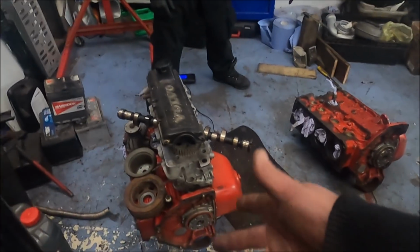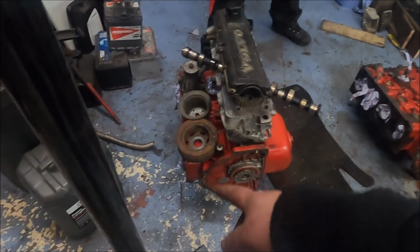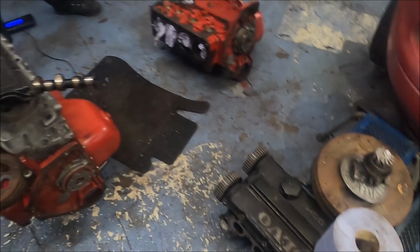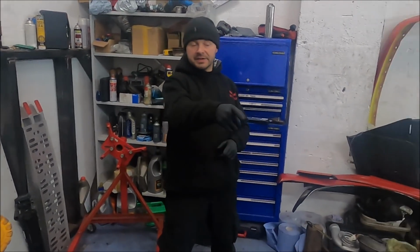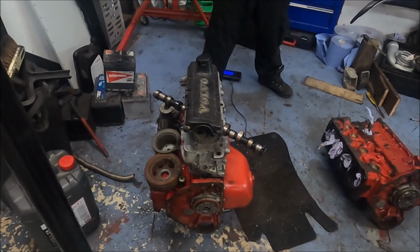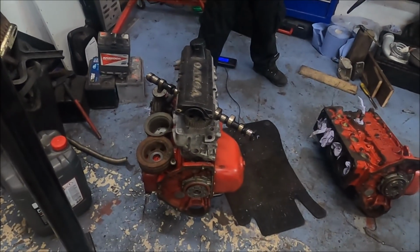And I mean, you can have a 5.5 kilo flywheel. Like I said, I've got a 5.5 kilo flywheel to go on. You could add to that if you wanted to. I've got my crank pulley, instead of that one, it's 0.8 kilos. Obviously a 16 valve head weighs a little bit more, not much I bet. What I'm saying is, you add 100 kilograms now, you're not adding another 100 kilograms with the gearbox. No, you're not. And as you see it now, with a very light panel, it weighs 200 kilograms. Yeah, 200 kilos. So a Volvo Redblock is certainly significantly lighter than a K24 Honda engine.